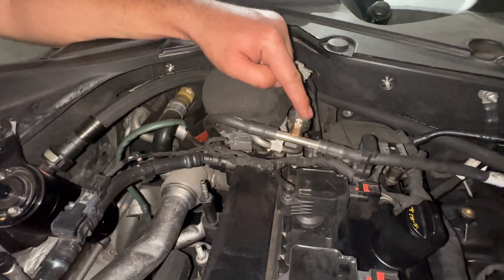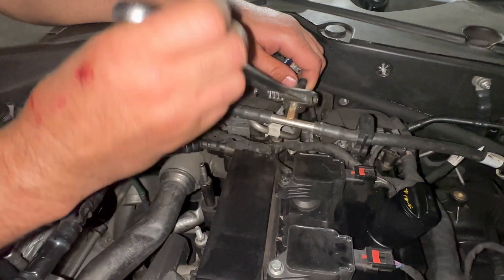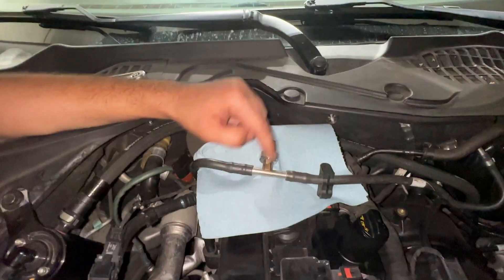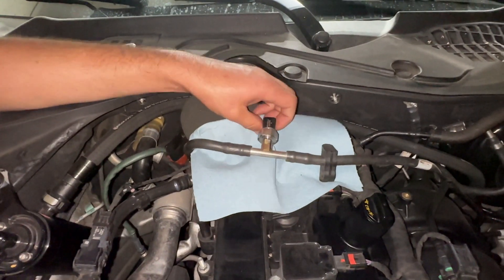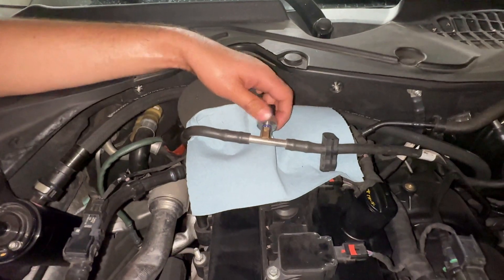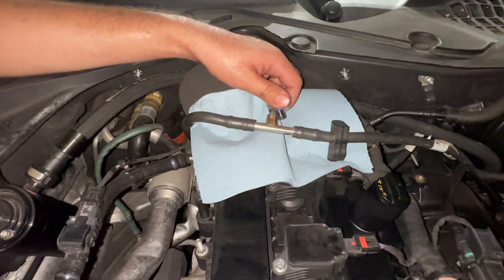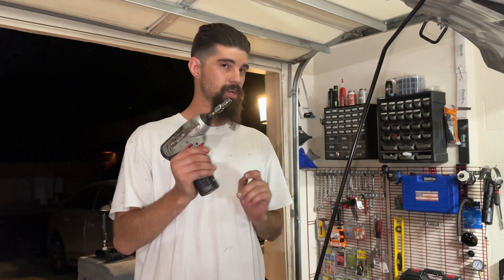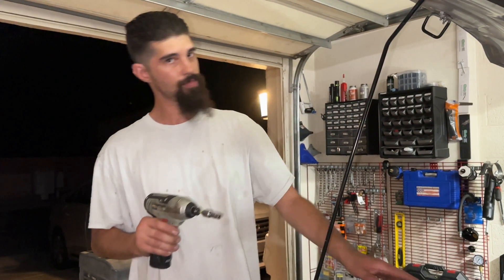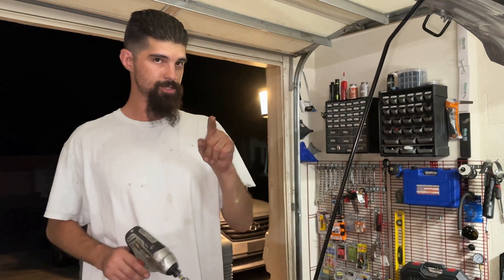If you don't know about that, I have a video referring to that, but today's video is not revolving around that. You're going to take yourself a monkey wrench, get it on there — lefty loosey, tighty righty. Once you get the napkins all ready, put them underneath the sensor, because this does spill fuel out. I'm going to start removing the sensor. Before we take off the intake runners, we're going to need a 7mm, and we're going to need to take off the intake by itself — not the runners, your actual intake where your filter goes.